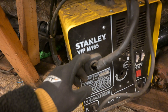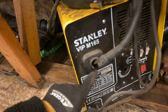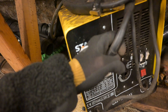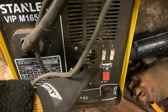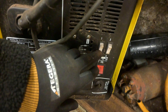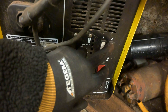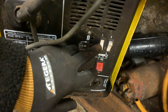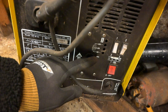There are a few downsides to it. As you can see, the MIG hose package here is hardwired straight into the welder itself, so it's not easily interchangeable. It only does MIG and nothing else. And there's not too much adjustability — all you have are these high and low switches to adjust your amperage. One and three is one setting, two and four is one setting, one and four, etc. And there was a knob here to control your wire feed speed.